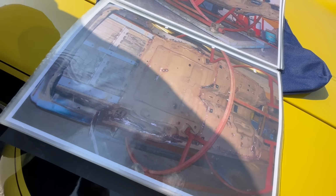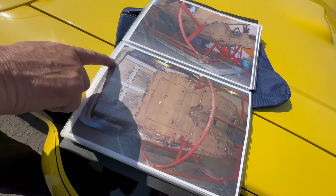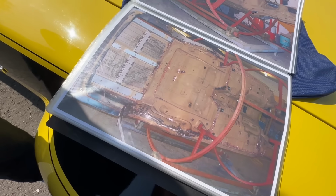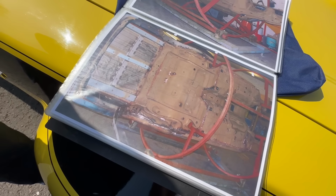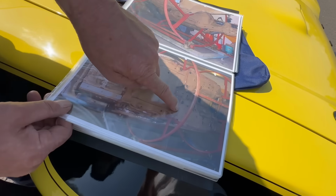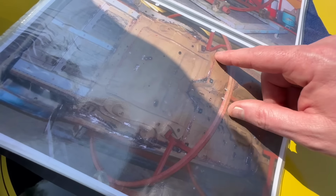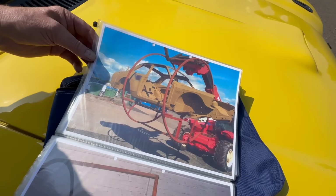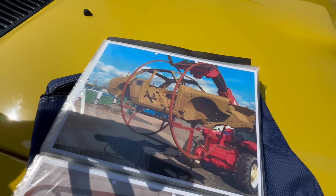So that's the Sierra floor pan with my made up boot panels in, and you can see the seam there. So you've shortened the Sierra floor pan 7 inches to get the length, and the weight. Then it was handy for taking it outside and blasting it.